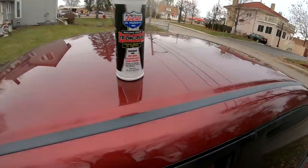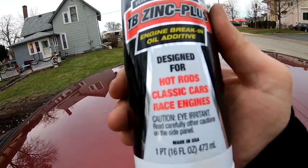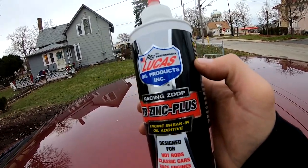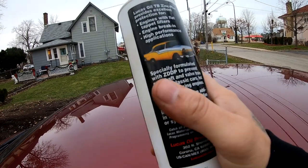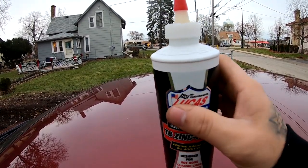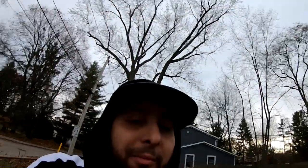And then what I'm gonna need to get this car to make boost. I went to the store and I bought this right here — this is gonna be mixed with my 5w30. It's a bunch of break-in additives. I'm supposed to add this whole container to my oil, so I'm gonna mix this with 5w30. I'm gonna wait 500 miles after I add this, then drain it and put new 5w30 again, and let it run another 500 miles before we go into any crazy boost.